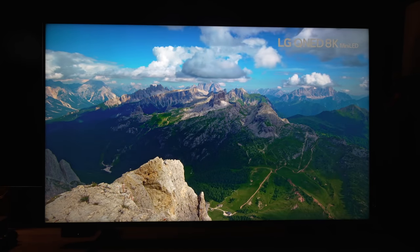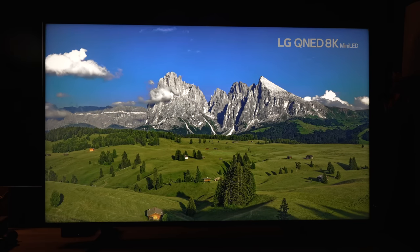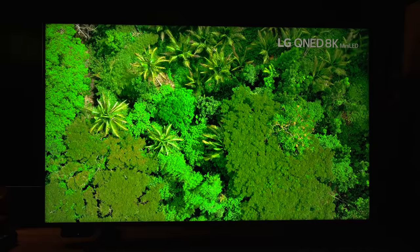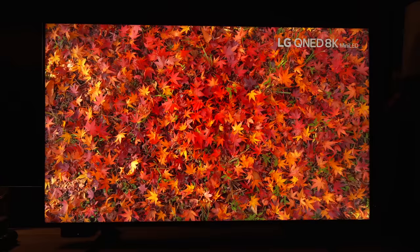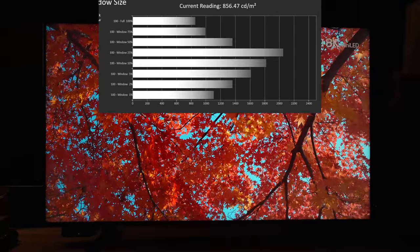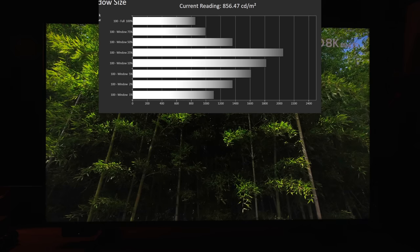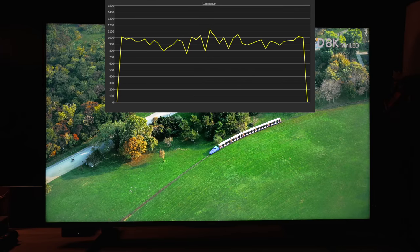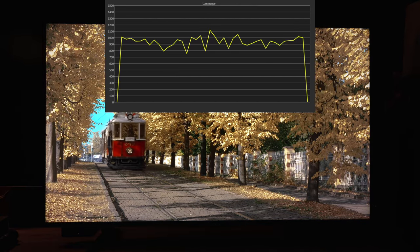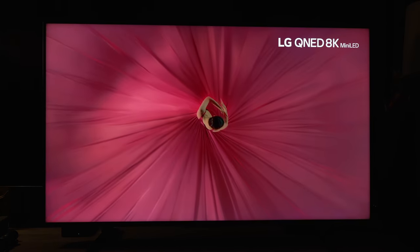What this TV does great is its HDR10 performance, which is really excellent for the price. The brightness is among the highest I've measured at any price point. Doing a typical Windows-style measurement, it goes from a little over 800 nits in a full-field window up to over 2,000 nits in a 25% window at D65. Using a new method for measuring brightness that represents real content with a highlight at different APL or average picture-level brightness, you can see on this chart that it holds that highlight roughly around 900 to 1,000 nits pretty consistently, rising quickly and dropping back quickly.